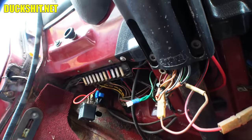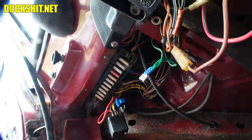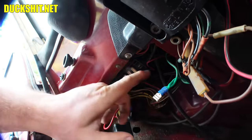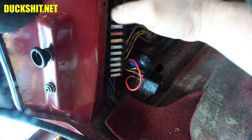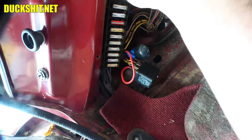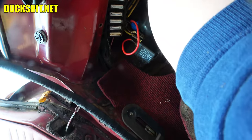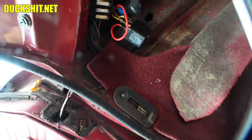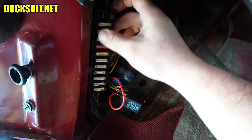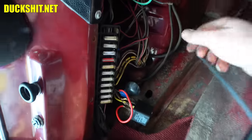Let's see if I can reach up under there and get to the back of that cable. I really don't want to have to take the dash apart and pull the gauges out and try to attack it from the front. But if I can't get to it, I might have to ask for help because my hands are just so damn big. It looks like I knocked one of the fuses out. I removed these two screws — the one here and the one there. Fuse block is now loose, which gives it just enough motion that I can get it out of the way. I got my fingers tangled with some wires — there we go, I'm in. And I saw sparks because I probably should have disconnected the battery before I got started here. I hope I didn't cook nothing. If I did, it's probably a fuse — I think we'll be okay.